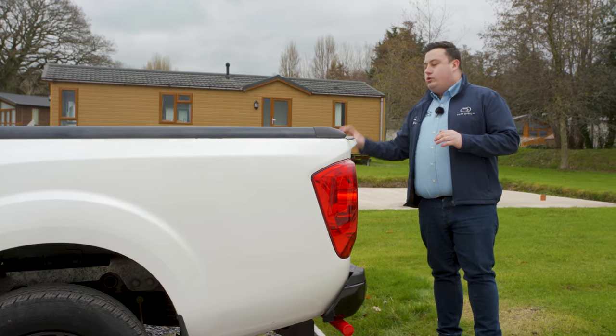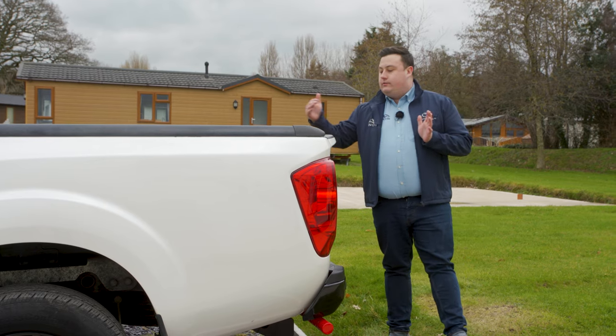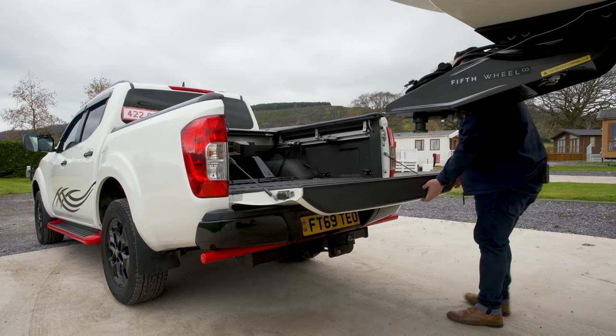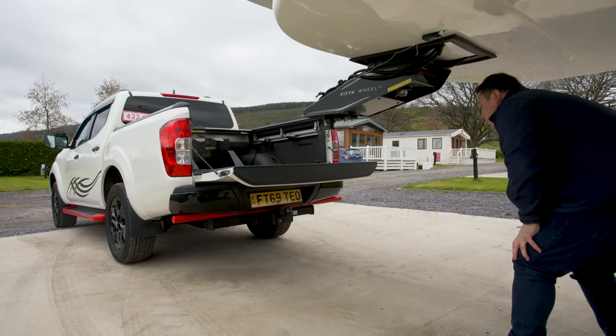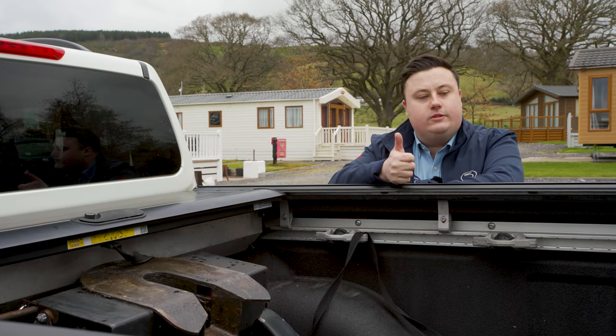We make sure the pin drops just below so that we can't see it anymore, and that means we have enough distance to then drop the tailgate down before backing up further and hooking on. Another tip: as well as the screws on the back of the tailgate, you can also use some tape on the lip of the tailgate.